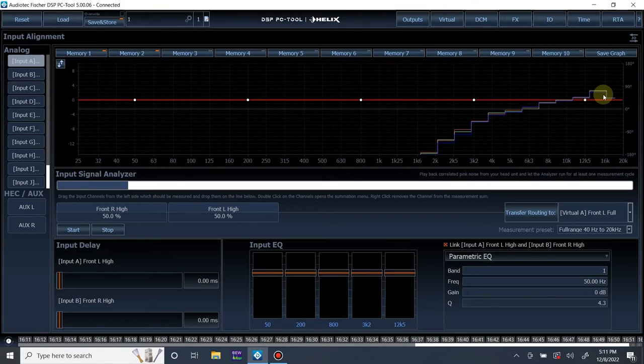So I'm not going to be able to measure one tweeter, let's say I measure the left tweeter and it has no EQ applied. It just has this crossover. And on the right side, they raise the volume to account for the distance of the right tweeter being further away, but they also do not apply EQ. They can actually look like they're the exact same, but the right tweeter may actually be louder. That is one thing I do not like about the Helix RTA. I wish it could show, instead of just a relative 0 dB, you know, up to down to like minus 15 and positive 10. I wish it actually showed SPL levels or voltage levels or something of the sort. But again, it's still useful in its own way.